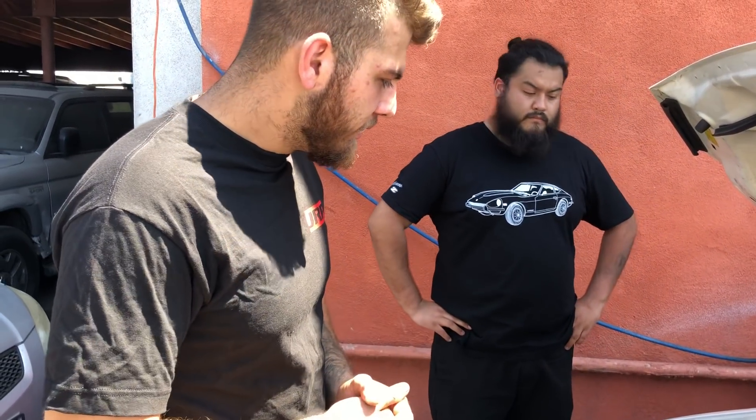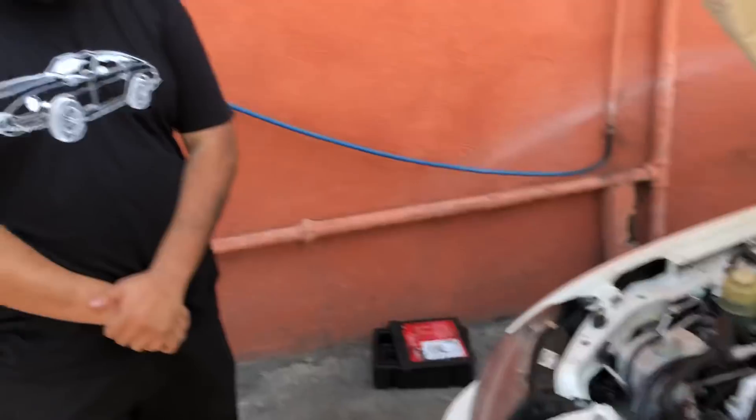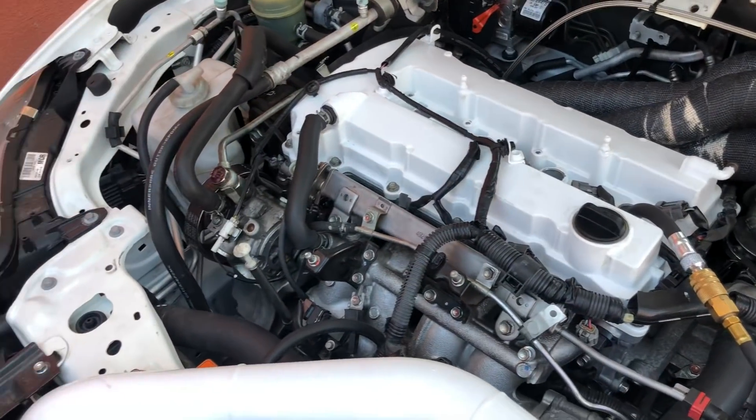Just wanted to give you guys a little tour of his car. He has a Sidewinder 6870 turbo — it's an Odyssey FAV Sidewinder kit straight from Florida with a Precision 6870 turbo. Of course, the motor is built by Ronnie at JRP. It's got a built transmission with 4.18 finals. He's going to try to make this a very fast half-mile car, so we took that into consideration when we built the motor. He is going to be spraying around 200 — about 200 shot of nitrous.